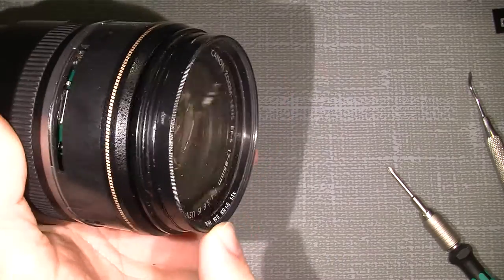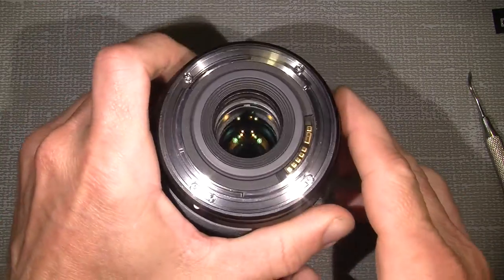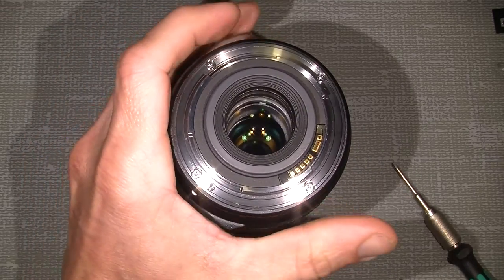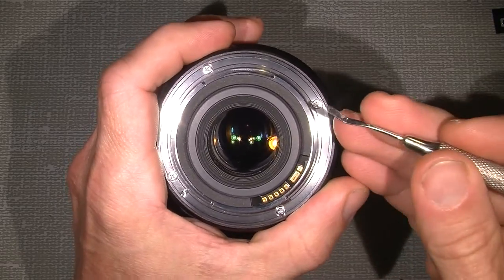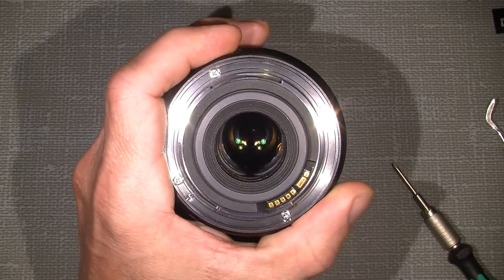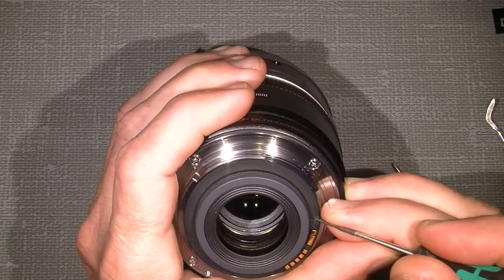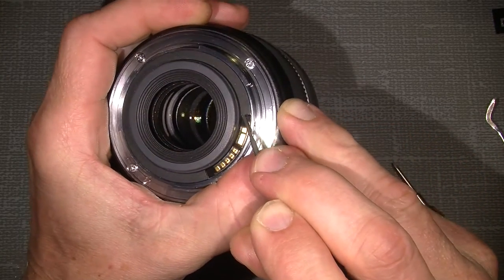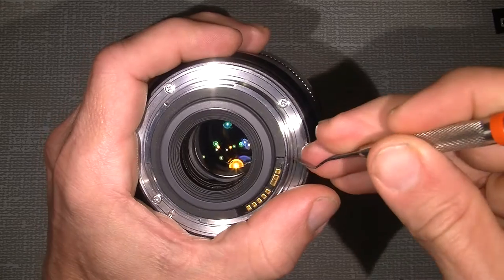Then we go to the back of the lens. There is a protection filter on this so I will not damage the front lens. This back part here has to come out — it's made of plastic. There's way too much plastic in this lens. I use my dentist tool; someone else can use a thin or very small flat-head screwdriver and put it right here, then gently push down and lift it up. It's a lot easier with this thin kind of spade.